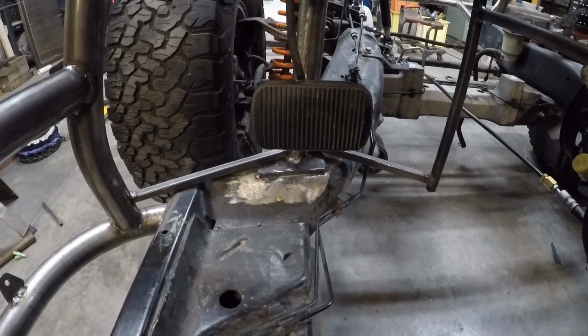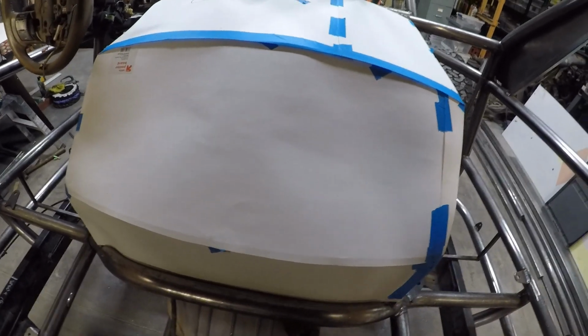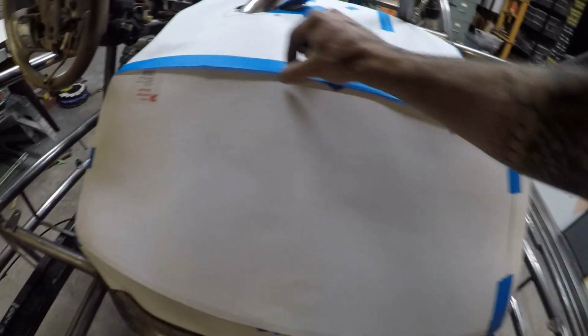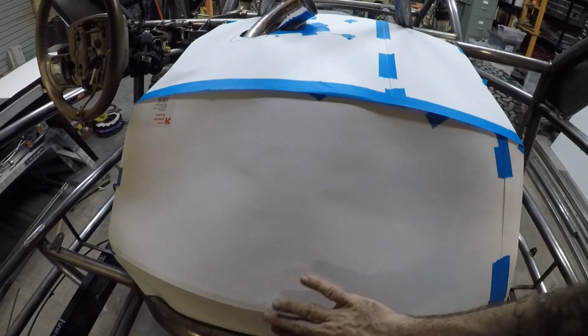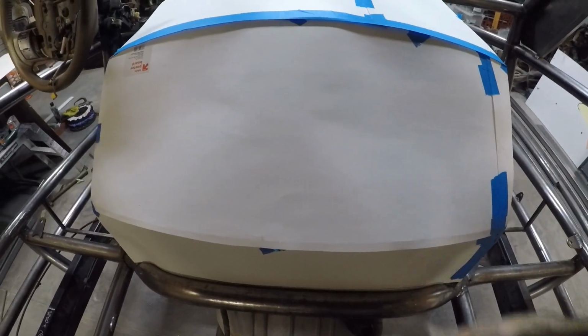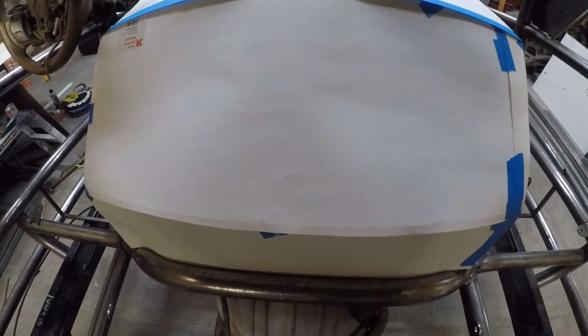The footwell for the driver's side needs to be a little bit different shapes because of course I have to fit the accelerator and brake pedals in there, so that'll be a little bit of work. But I just wanted to show you guys how it looks to mock up the poster board, because these are going to be the most difficult pieces because they're oddly shaped, and then I'm going to have to do a slight roll. And unfortunately, I'm not going to be able to use my brake, the cool guy brake over there, to make the slight bends for this piece, because as you can see, it's got kind of a goofy curve to it. So I'll show you what I'll do when you've got a curve that needs to be bent. It's kind of fun, actually.